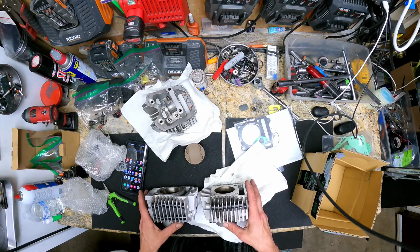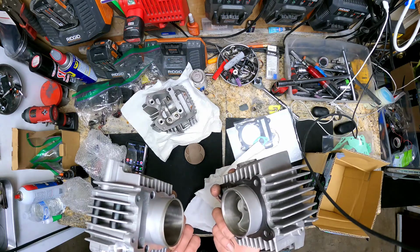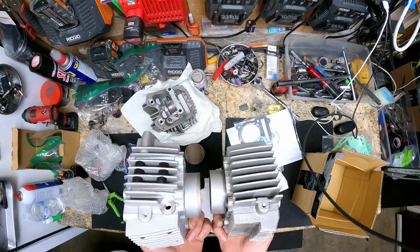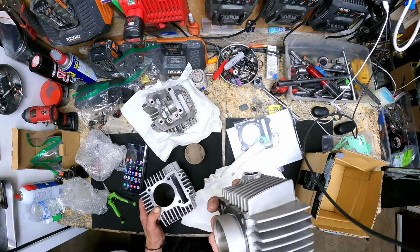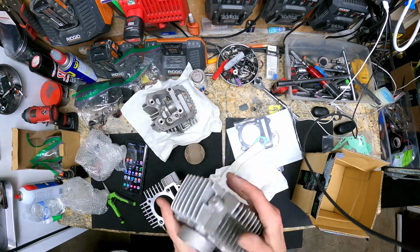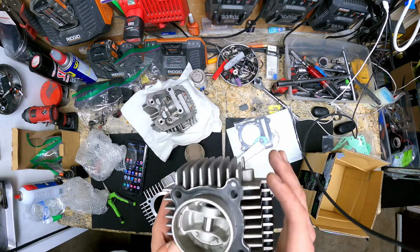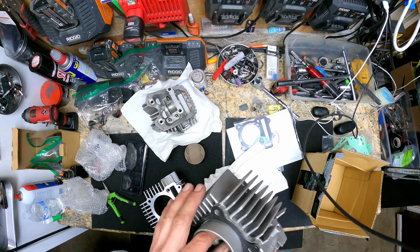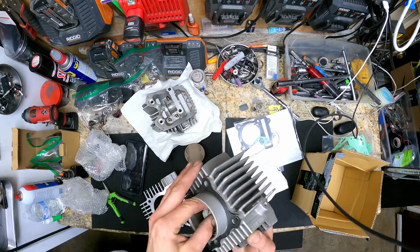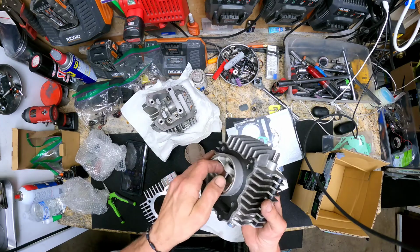So what I'll do is I'll get some mic readings. See this? This is what it tells me too. You see the electroplating all up the side of this? Where is this electroplating? It stops short. That's the problem right off the bat, right there. See that? Not that it probably really means anything, but I just think this is a super light, crappy coating. It looks good. Look, dude, the piston looks brand new on the other side. Look at that. And you pull this bad boy out. Oh, tight fit in too. Easy, easy. Okay.